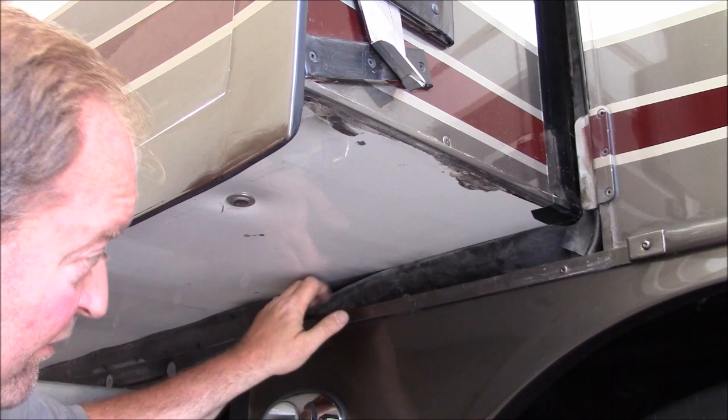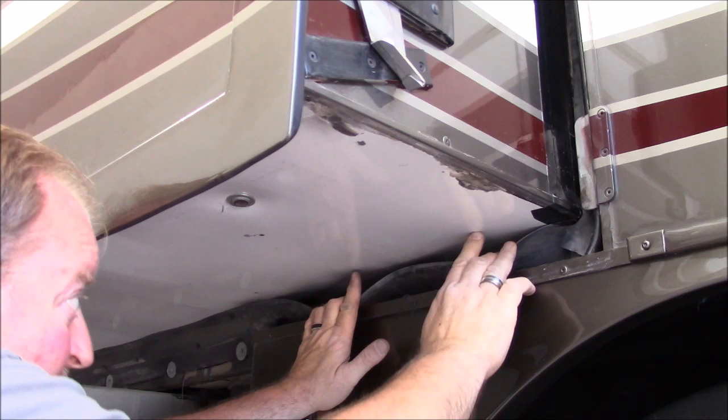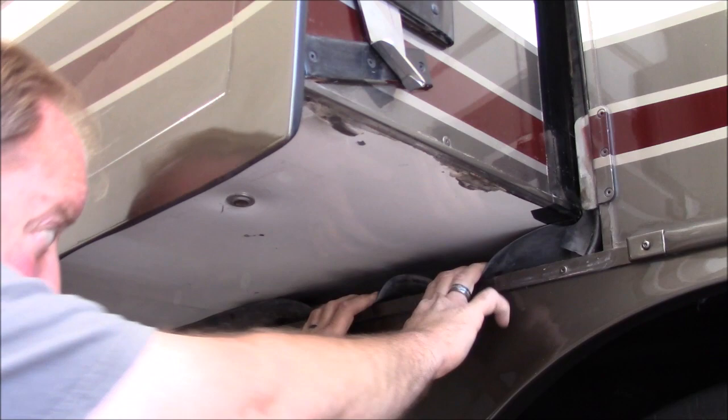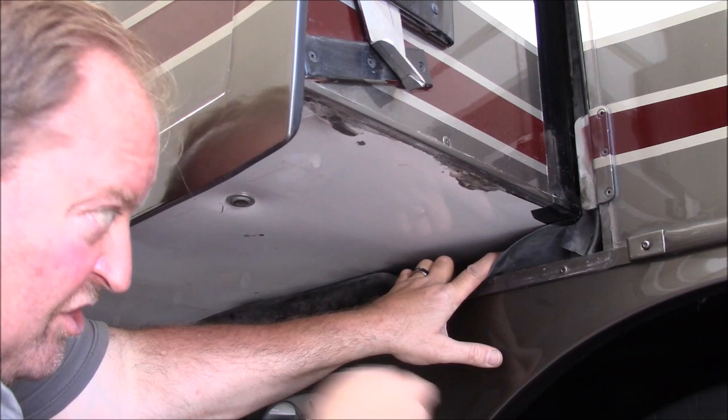So you can just pull this flap down and I can see my roller very plainly right there mounted to the framework, and I can see right where it rides here on the white laminate underneath. So that's where my roller plate's going to go. Then I'm going to have a 3-inch, an RF300, encapsulating the corner here. Now, when you measure the length of what you need, you're going to want to measure to the center of that roller out to this outer bracket out here, and you're going to want to add an inch so that the roller plate goes just beyond the roller.